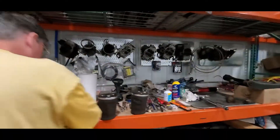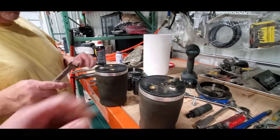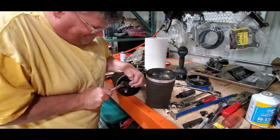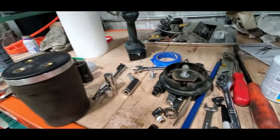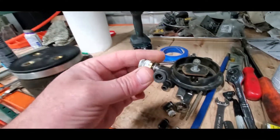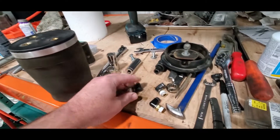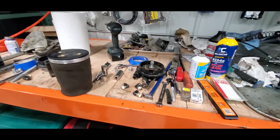We just took the cups off real quick — that's going to make it easier to not only change these but to clean the top and make sure nothing looks damaged. While loosening we discovered: to do the spring pocket thing they just hacked down some washers to bridge it, and lo and behold that rubbed into one of them — and there's our leak. We're not crazy. Right now it's a slow leak but eventually it won't be, so we're going to get a little more creative here.